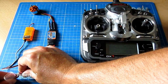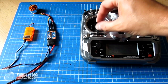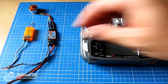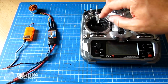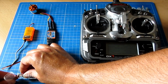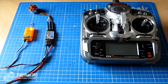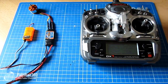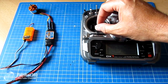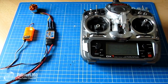If we unplug it, next time we plug it in it remembers and stores those endpoints so it'll work every time. To summarize: throttle to the very top, then power on the ESC to show it what 100% looks like, then put the throttle down to the lowest position, wait for the confirmation tones, and you have it calibrated for your radio.